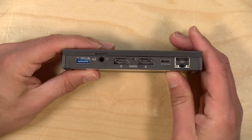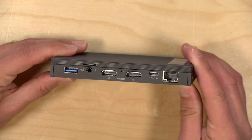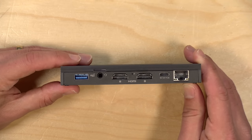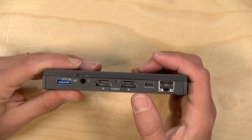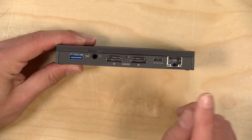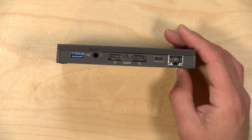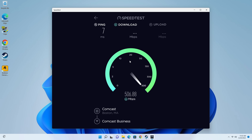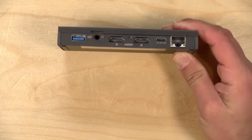Next to the HDMI is a USB Type-C port, but they are very specific that this is not a standard power delivery port and won't work with USB docking stations. They want you to use their included 12V 2A wall wart power supply. It would be nice to see a full-service USB-C port like many mini PCs offer these days. There's also a gigabit ethernet port, and it has Wi-Fi 6 on board — an Intel chip — getting 500 megabits per second downstream off my gigabit connection.